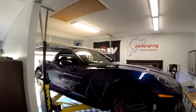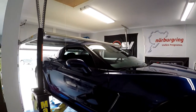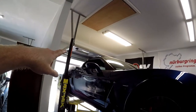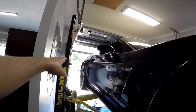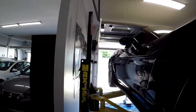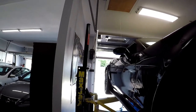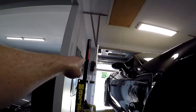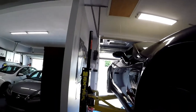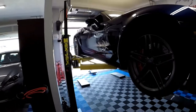That's how you raise your lowered Corvette with side skirts and everything using Max Jacks. You might be concerned about the roof hitting the garage door, but there's about a one to two inch gap up there - it's real tight but I've measured it and we're good. I couldn't do that with the SS - I'd have to get a high-lift door conversion to move the garage door track arms up close to the ceiling. That's probably around a thousand dollars once you account for moving the lift master, springs, and tracks.